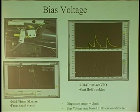How do you think we get codes that say circuit high, circuit open or shorted? Wheel speed sensor open or shorted. Now, a wheel speed sensor produces its own AC voltage. You know, it's a magnetic sensor that goes, hey, how you doing? AC on both lines, right? How does the computer know it's open? What computers do, they do an integrity check. They will send a minute amount of voltage, and we don't know what it's going to be. It could be 4 volts. It could be 7 volts. It'll send voltage down one line and a ground down the other.